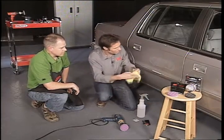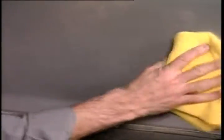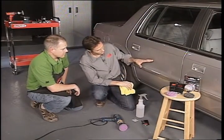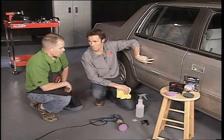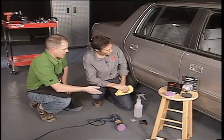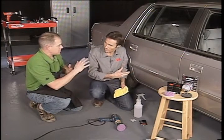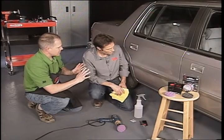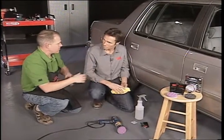So we can see it's got a little powdery residue. If I wipe that off — wow, it's taken the scratches away and now it's just a dull surface. If we were still seeing that big scratch, we would want to sand a little bit more. Just keep going until you get rid of it, but keep checking as you go. Once you get the scratch out, you don't want to sand any more than that on your clear coat — you want to move on to polishing.